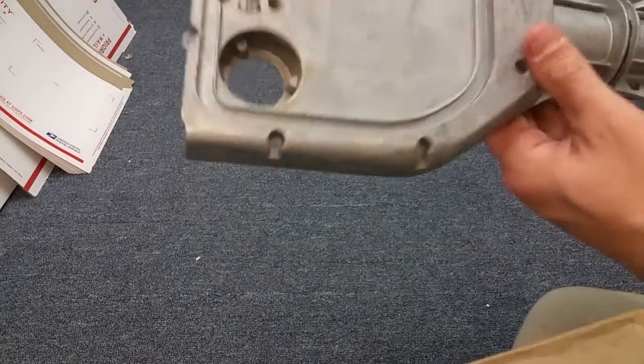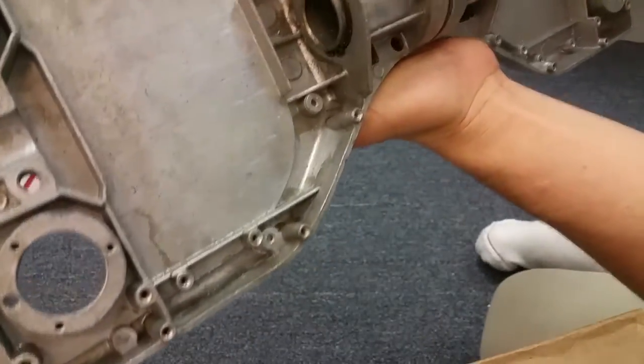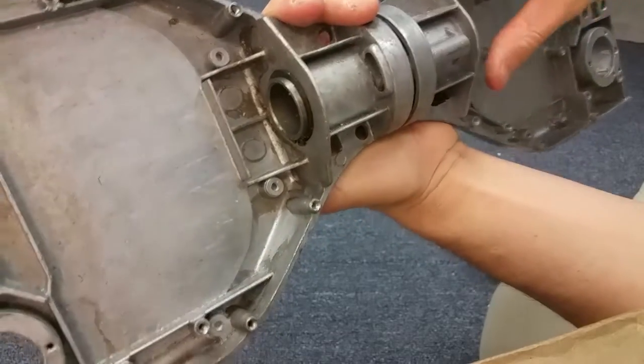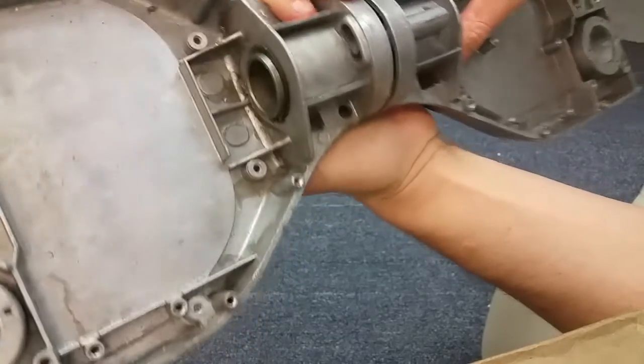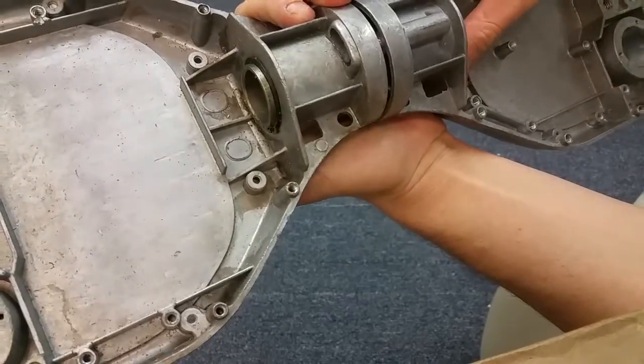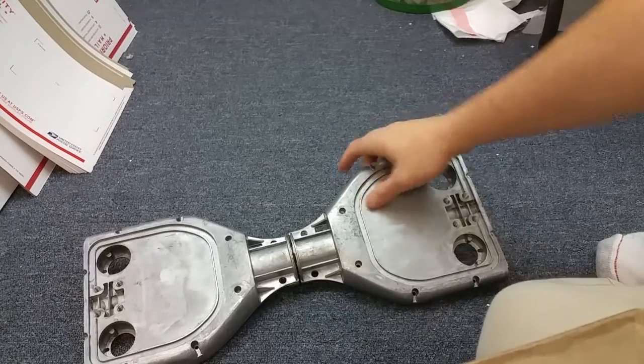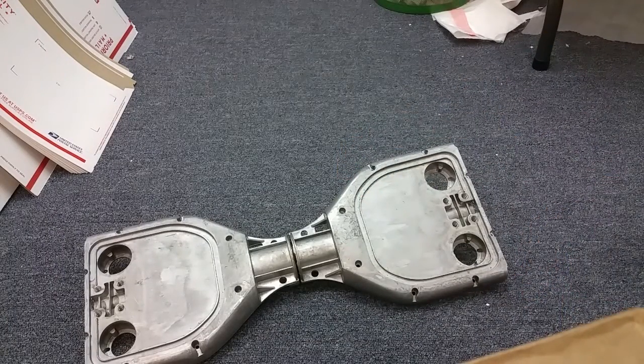The other area where I've seen them break, which is probably more common — if you can see inside of there, there's a pin. This basically keeps the board from over-rotating. If this pin cracked, the board would literally do 360s and you wouldn't be able to ride it. But the frames are one of the pieces that can go bad.